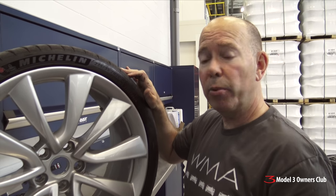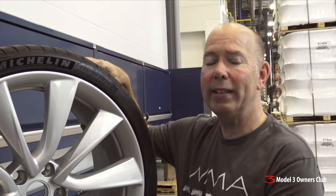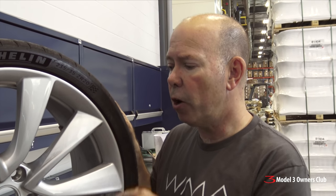For today's experiment, we want to know the overall assembly weight — total wheel and tire weight — and then change to something lighter to improve the car's acceleration. It's intuitive that removing weight helps, but what's special about wheel weight is you're not only making the whole car lighter, you're reducing the rotational inertia — the energy required to get them spinning. That is free horsepower; it's two to three times the effect of removing static weight.